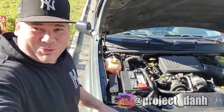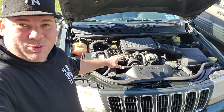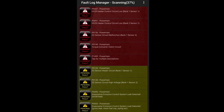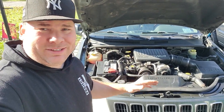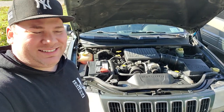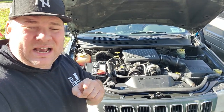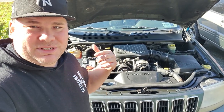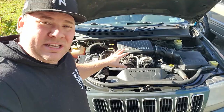Hey, what's up guys? I'm Dan H. and welcome to the project. Today we are here again with our 2002 Jeep Grand Cherokee WJ — the Green Hornet, 4.7 — and it's got some check engine light issues. As you can see from the intro, I've been battling some codes. I got this 1499 code — the hydraulic fan solenoid code — and that trips on immediately after I clear it. Five seconds after I start the ignition, boom, code. I also got a ton of oxygen sensor codes that keep popping up after I clear it. So I got two things going on, and today we're going to solve it. I'm getting close — let me bring you up to speed.